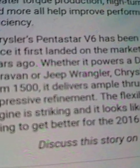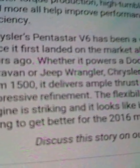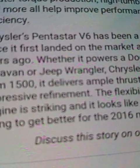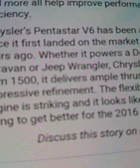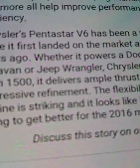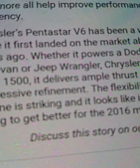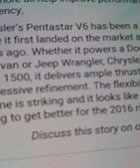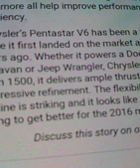But the problem with this transmission, you have to use ATF Plus, which is a little bit pricey, but that's not really the problem. When you service this transmission, unlike the 62TE, which you could take the bottom off, take the filter out, and drain it, and do it a few times and get everything out of the converter, this one, you can't. You have to pull it out of the car. To pull the filter out, the tranny's got to come out of the car. I've checked, many people I've talked to, quite a few Mopar mechanics, and that's what they're saying. The thing is, it's a little bit different kind of filter, so it may not need to be changed as much. But maybe it's just made good through warranty, and whatever. They don't give a rip after that. I'm not really sure.